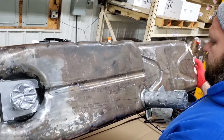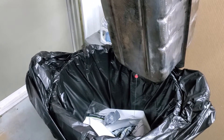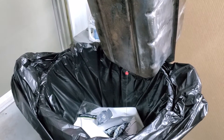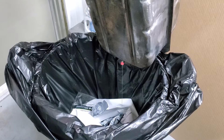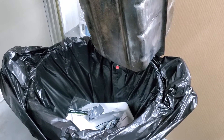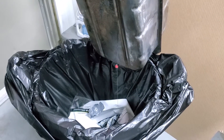We're now at the point of draining the tank. We've been rolling it around for almost two hours to make sure the whole inside is coated. To drain it, take a wire connector, cut the end off, and screw it into the drain hole — it protects the threads while still allowing the tank sealer to flow out. Once it completely stops running out, continually rotate and flip-flop the tank about every 15 to 20 minutes until the tank sealer stiffens up.